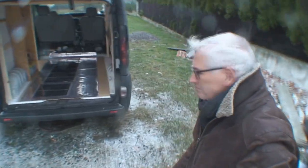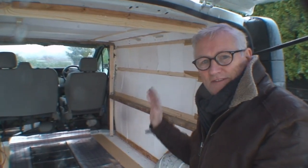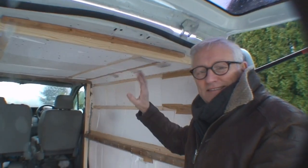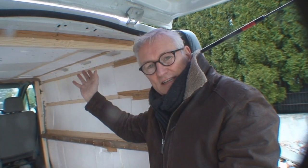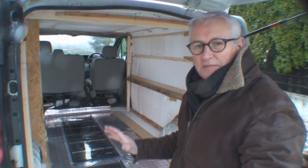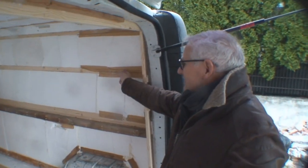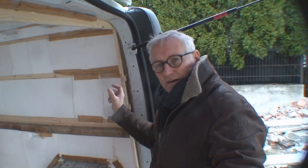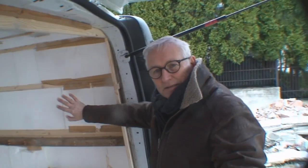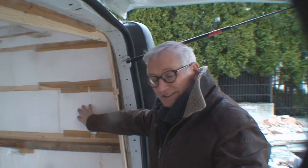What we've done here is I've insulated the inside of the van. I've done quite a big job because I've double insulated this with styrofoam — all this is double styrofoam — and I've left the old insulator that was in there before. The plan is to keep this open space as wide and open as possible. I wanted to get all the fixtures in before I put my styrofoam on the floor and the walls, and I put these battens in so that they're basically the same thickness as the styrofoam I was using. Then I pushed in some insulator behind that and put my final coat of styrofoam on the surface. Polystyrene styrofoam — same thing.